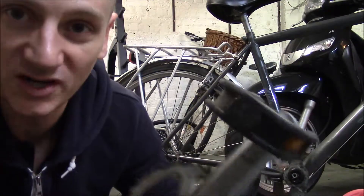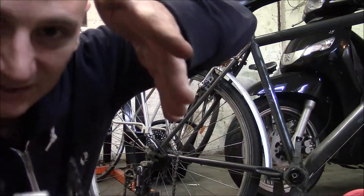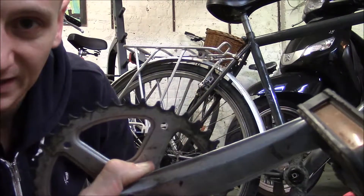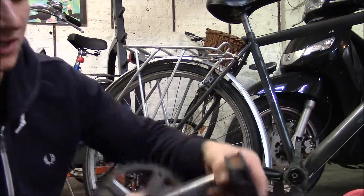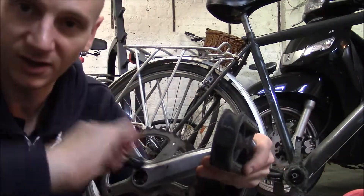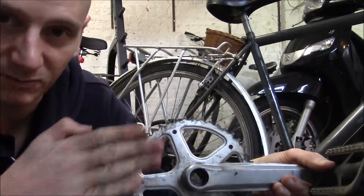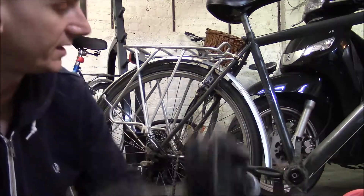You need to twist the arm — the crank arm and the crank removal tool need to come together. Keep turning: turn the crank removal tool clockwise or the pedal anti-clockwise until you feel it wobble and then it'll come off. A good way of checking if you're doing this right is to stand over the bike and look down — check that the front sprocket is moving away from the frame as you're turning the crank removal tool. That's how you know you're making progress. You'll feel it wobble and then it'll finally come off.